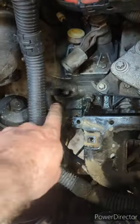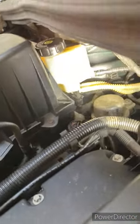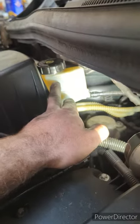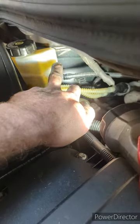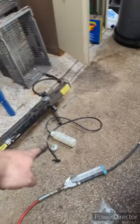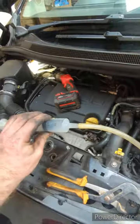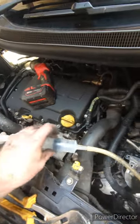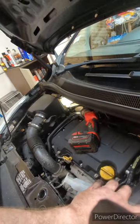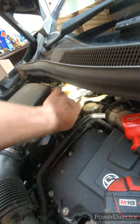This just caught me out — the bleeder is there. Pull that rubber bung off and you can put your tube on like you normally bleed brakes. But what caught me out: this is actually split into two. There's a reservoir for the brakes and also one for the clutch. What I did by mistake was draw fluid through with the pressure bleeder — it ended up on the floor and the clutch stopped working completely. What you have to do is get a syringe, fill it with brake fluid, put it on there, take the cap off over there and force it in this way — have the valve open and pump it in, and it comes out there. Because it is double-skinned and there's only a tiny, tiny reservoir for the clutch.